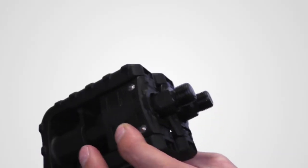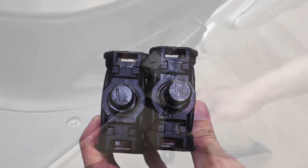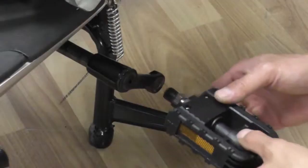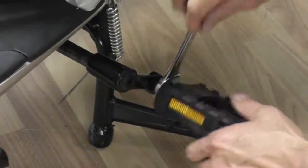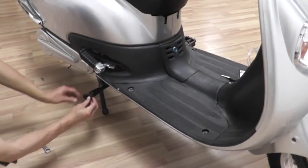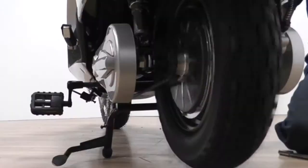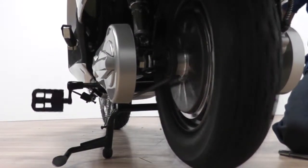The last piece you'll need to install are the pedals. Note that this bike does not have similar pedals or pedal cranks. Attach the crank by pushing it in and place the cover on. Then attach the pedal and tighten it with a wrench. Repeat these steps on the other side. Note that the pedal cranks should be parallel and pointing in opposite directions. Attach the pedal and tighten it with a wrench. Check to ensure that the chains properly spin when the pedals are rotated.